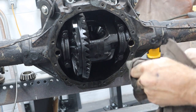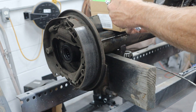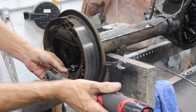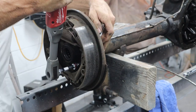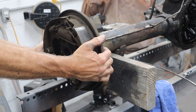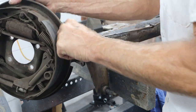Let's strip the ends off this axle. I'm going to get the brake line loose — ideally I'd just like to take the four bolts and take this whole assembly off and throw it in a box. These don't look corroded, so hopefully they'll pop loose real easy. You've got to love that. If things go well, smack this with a hammer, take the whole thing off, and move to the other side. We won't have to mess around with taking the brakes apart. At least one thing went easy on this car.